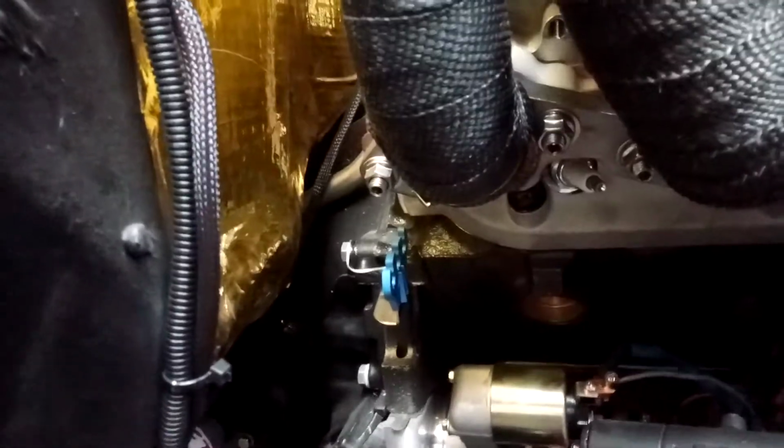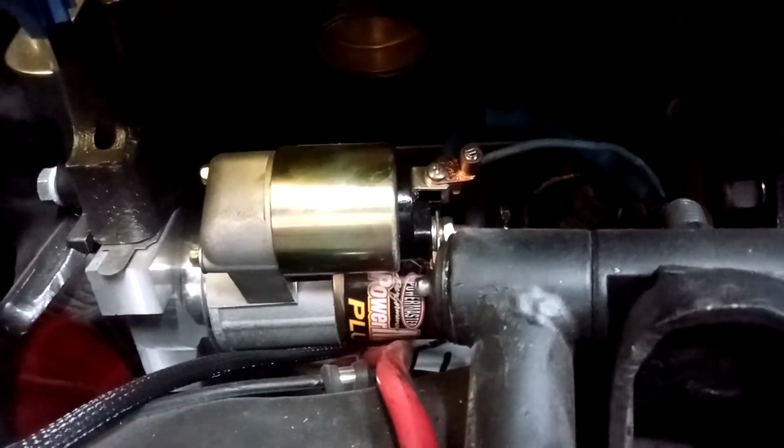Modified my plug wire looms that I had on it before, well, at least one of them on either side, the 4-wire loom. So when I run them down underneath the header, I got something to put them in when they run up the back of the motor up to the distributor. Got tired of crimps, so I got that little thing on there for the ignition wire.